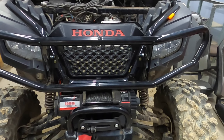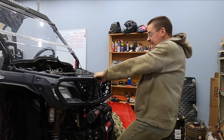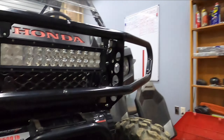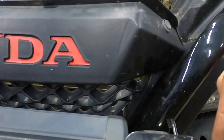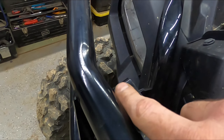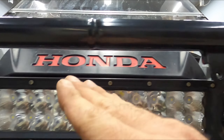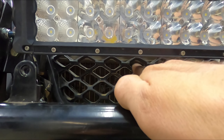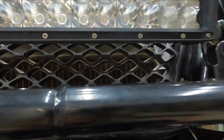There she is — all mounted, guys. I've got those two on right there, I've got my bottom brackets on. Looking good, besides being dirty from my dirty hands. She's running good. I did decide to mount my light bar behind this plastic piece — it worked perfectly. This bar had these little tabs that come up and were bent. I just drilled through here, took a piece of solid aluminum round stock and drilled a hole in it to use as a spacer on each side to lower this down. That fits perfect. Nice thing is, this is actually up high enough where I'm up above the radiator.